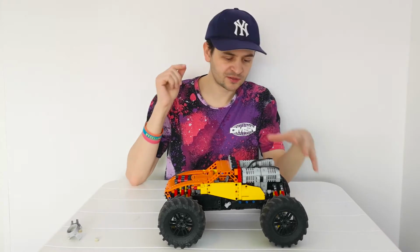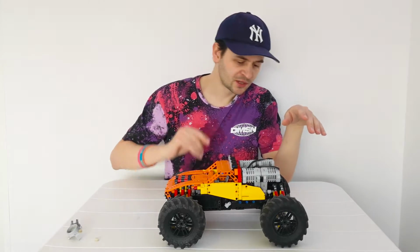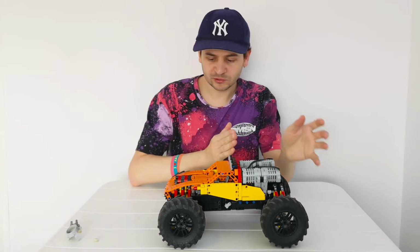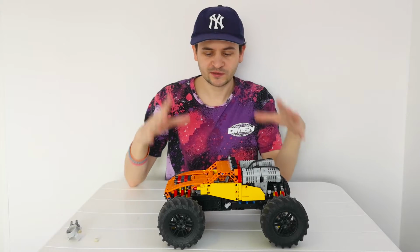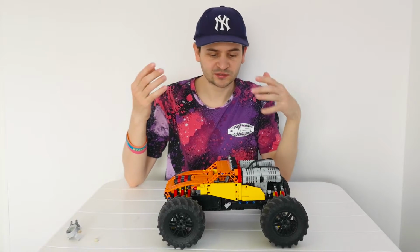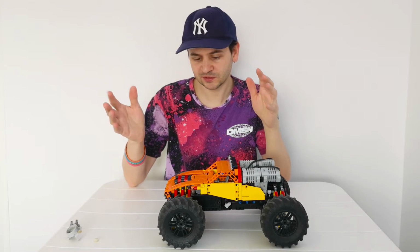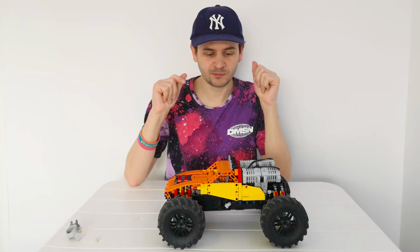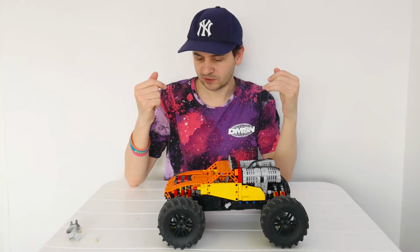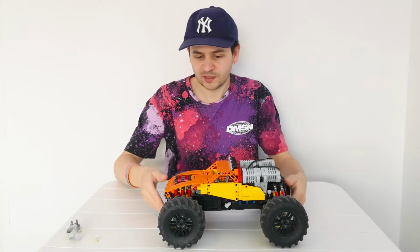because there are always some components that will have to be there. There will always have to be wheels, there will always have to be a steering servo, there will always have to be suspension, no matter if you make it with one motor or 20 motors. And these are the fixed pieces, the fixed weight that you cannot remove from the equation. So the bigger and the heavier model it is, usually it has a better power to weight ratio. So I had to find the middle ground,